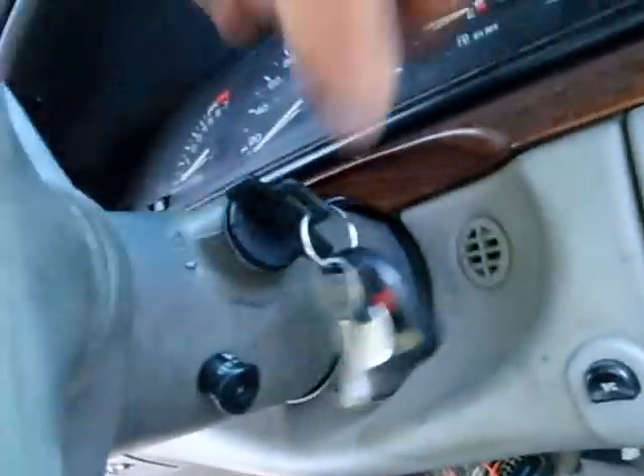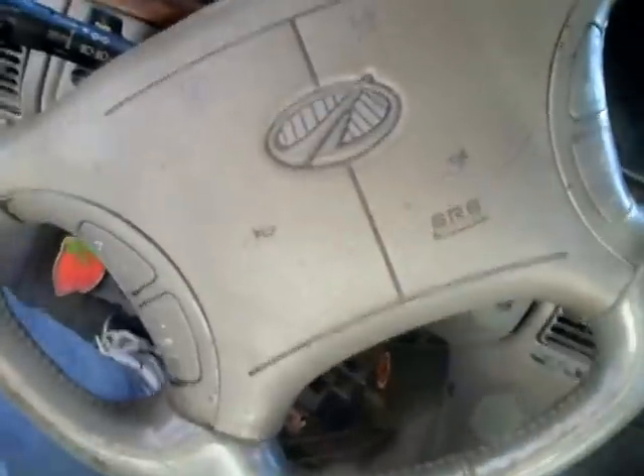You also have to remember — make sure you do not cut any of the yellow wires that come from under your dash, because those are the airbag wires. I just can't see you wanting to sit in a seat with an airbag going off. So, there you had it — I'll break out my solder and iron and have at her.